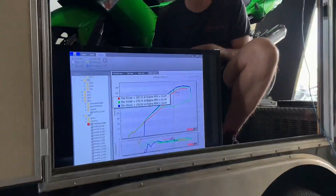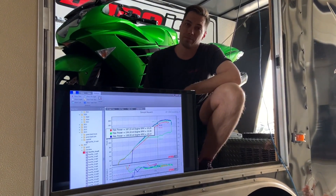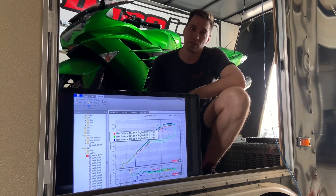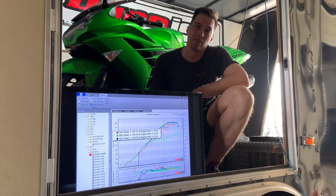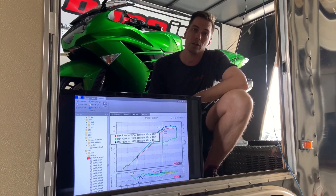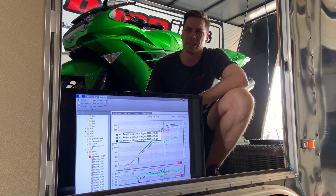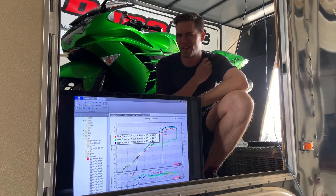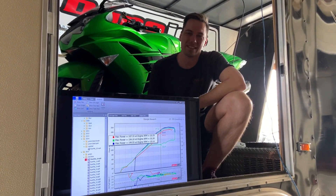Across the board, once we switched over to E85, I've seen that about anything making around 200 horsepower, about 5 horsepower is the difference on E85. The hotter the day, the bigger the difference we'll see. I have seen as high as 7 horsepower difference on a 105-degree day, but today got a little bit chillier. By up-north standards it's not chilly, but by Texas standards it is — we're about 70 degrees today.